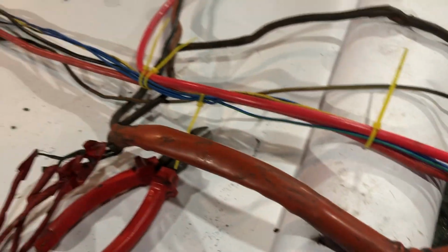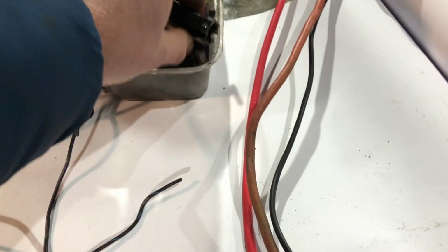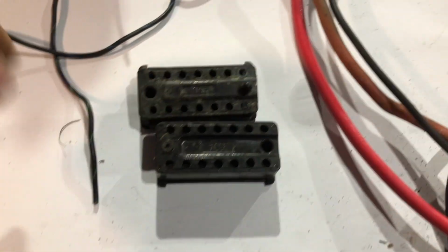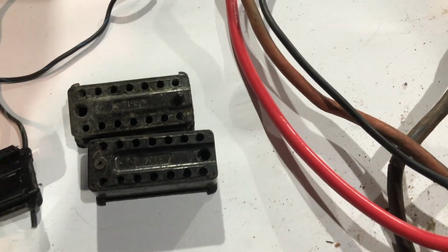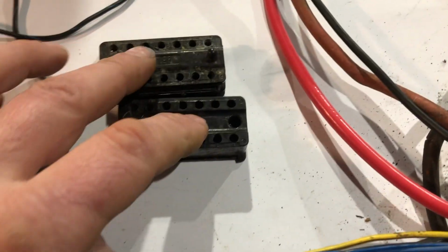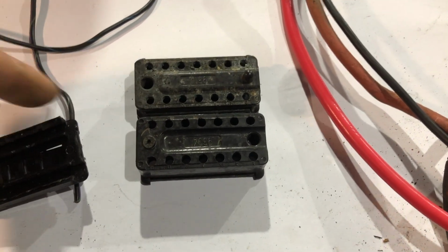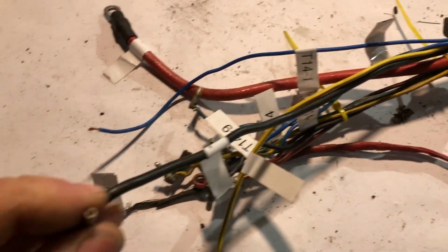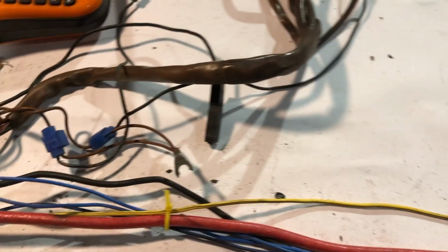The connectors are here, so these are the Mercedes ones. Got a variety, but there's only two that fit together, but luckily there was a male and a female available, so I can make two bigger ones from this and replace the one in the car, I think, like I said previously. So the next phase is to just complete this, make sure the lengths are all right, and then do the business up here by soldering on bigger sockets on, or bigger prongs actually from the old stuff.